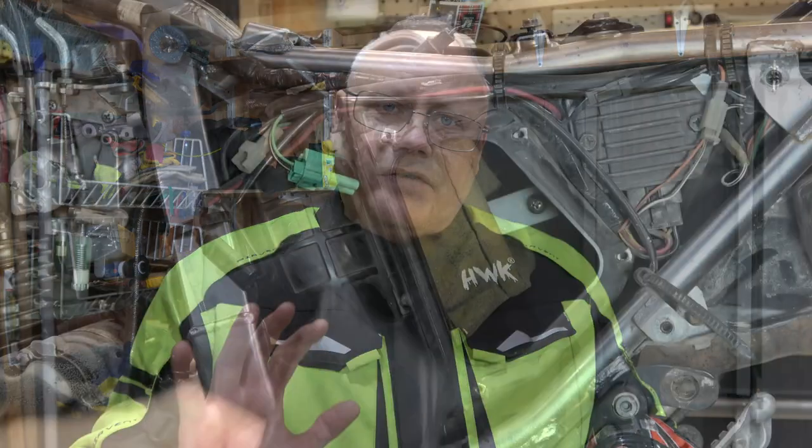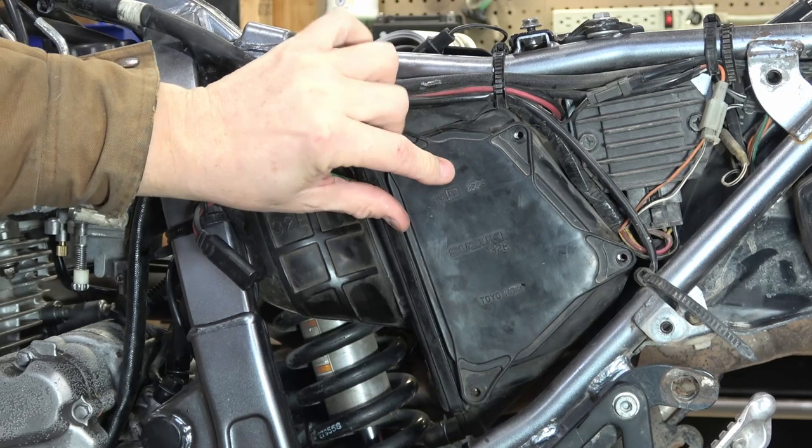This would give an entire open air box to provide that additional air. When I took it out, it idled okay, but mid-range and top-end the bike really fell flat on its face. I came home and put on the factory cover again, thinking maybe it was running a little bit lean. I took it out for a quick ride and sure enough, mid-range and top-end performance improved tremendously. Without an aftermarket exhaust or other tuning modifications, and running the smallest of the three main jets ProCycle provided, I probably could get away without even modifying the air box — and that's what I'm going to try today.